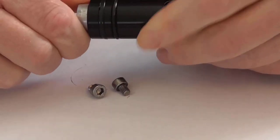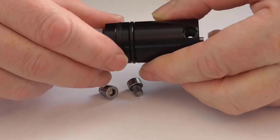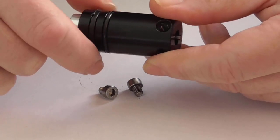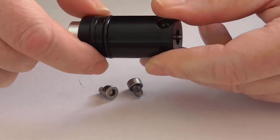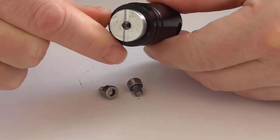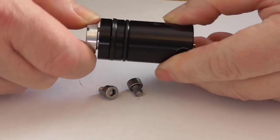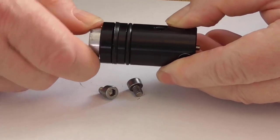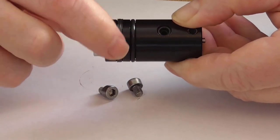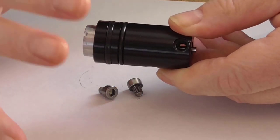And then once it's inserted into the cylinder, you've got your standard O-ring just there, and then there's another rubber ring there. What happens when you pull it in, it's got like a flathead top so you can put a screwdriver in. You tighten that up when it's in, and that collar there pushes against the rubber, and that creates a seal within the cylinder as well. It actually makes it expand a bit.